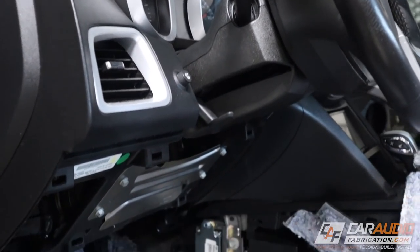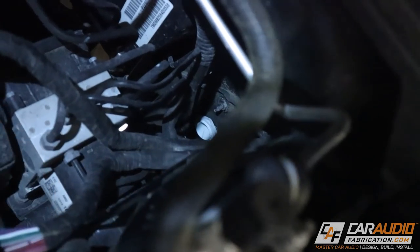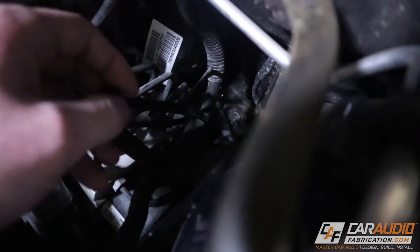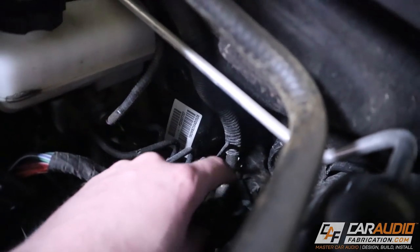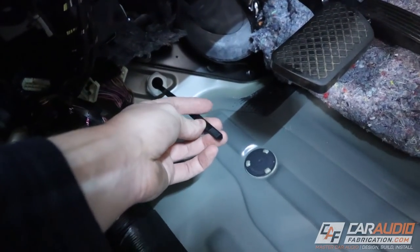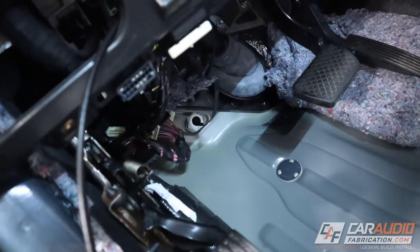I took care of the most daunting task first — I made a hole in the firewall here on the driver's side. I looked around and there were no existing locations that I could go through. So I had to check on both sides of the firewall and make sure there was clearance, then I drilled a hole and installed this grommet. Within the engine bay, you can see the other side right there. Here's a nice trick: you can take a larger zip tie like this — with this long, stiff zip tie it's easy to put it through the hole and then fish it out the other side. We can use some electrical tape and tape our power wire to this so we can pull it back up through the engine compartment where we want it to run.